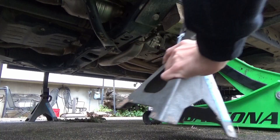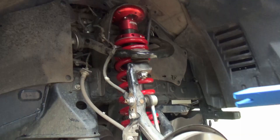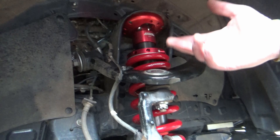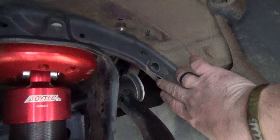We're actually going to do the UCAs first, just because we think it's going to be the most painful, so we want to get that done. We're going to remove the sway bar end link, remove this 12mm brake line, remove the 10mm ABS sensor, remove the cotter pin, loosen the ball joint nut, separate the ball joint from the spindle, remove the inner splash seals, and then gently massage this inner trim out so that we can remove the upper control arm bolt, which runs the entire length of this. And Toyota did not engineer this to be very easy.